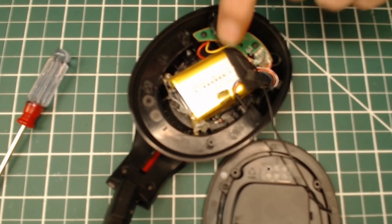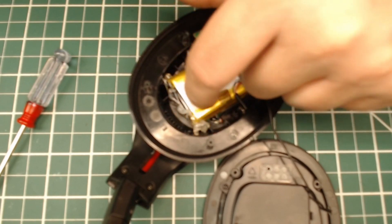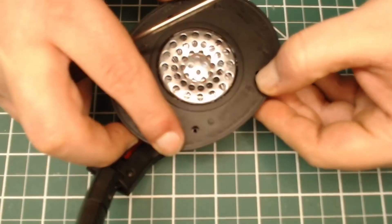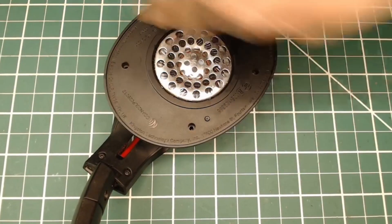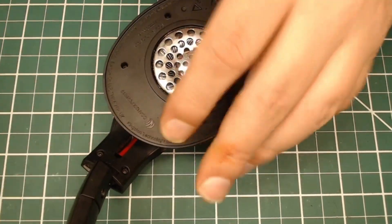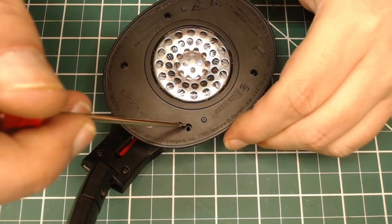That should be good. Now testing — making sure there's no bulge, there's space, and it's as flat as possible. Pretty happy with the results. Put the cover back on and should be good to go, right? Wrong — because it's a 10mm thick battery, it presents a little different issues than the 1800 upgrade and especially different from the 1500 which is really thin and flat. The 10mm thickness caused an issue because of the thickness of the battery, so you're going to have to reroute some of the cable management inside.